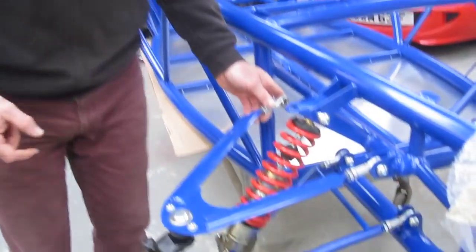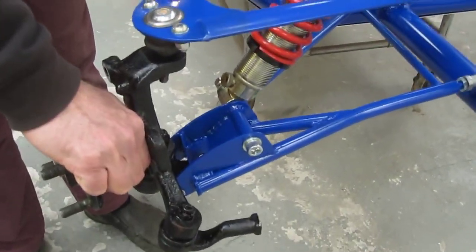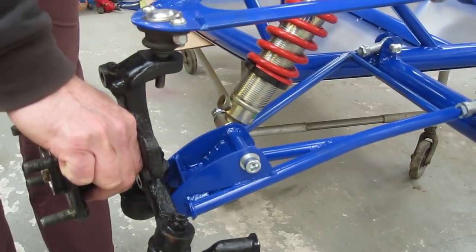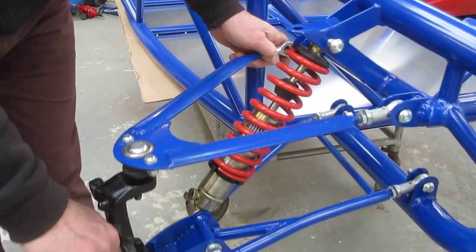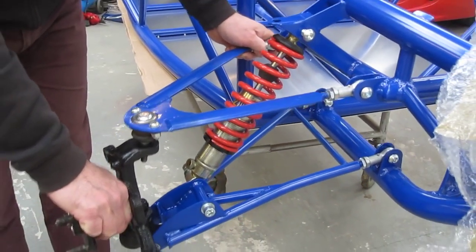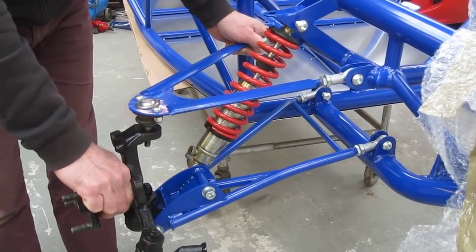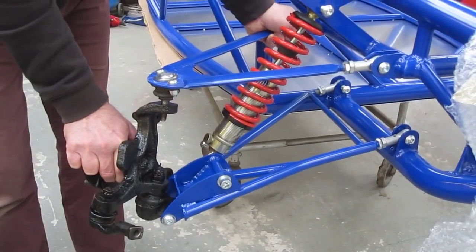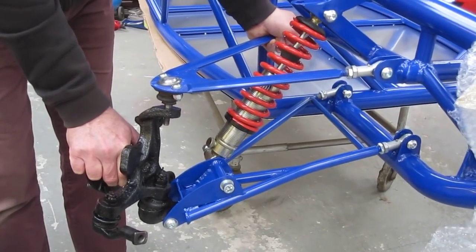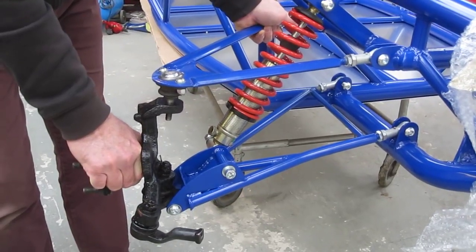On this particular car we're just setting up, it's quite interesting to note that the bottom ball joint appears to be locking out. When I try to position the top wishbone in its correct place with the bolt here, I can feel stiffness coming on and it won't really rotate without forcing it. We don't want that resistance. As I rotate the hub, I can feel the resistance easing off and the bolt hole lines up on the top wishbone. As I rotate the hub back, it's pulling again and I can feel that resistance.